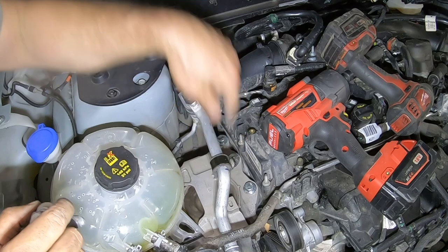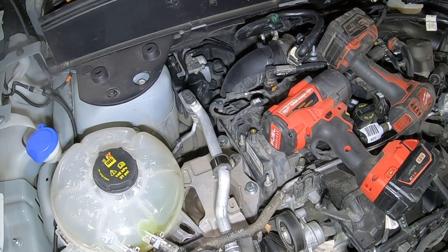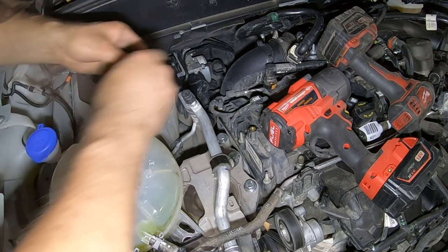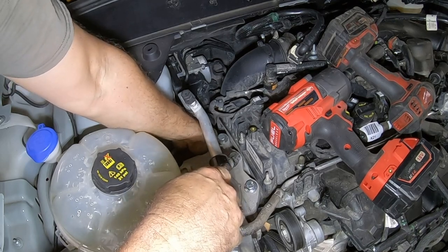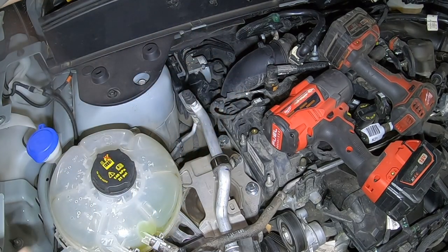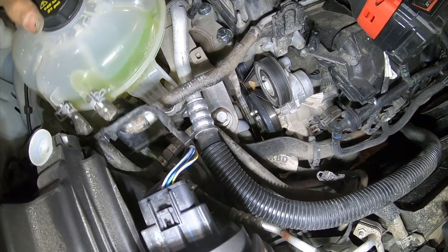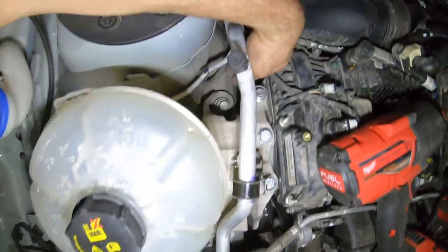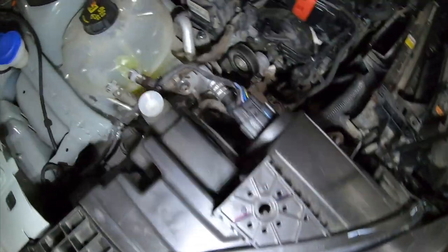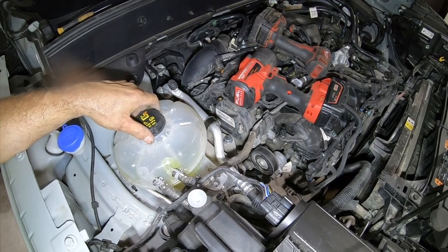As you can see, we're a little off here — the engine has shifted that way a little bit, which I think we can correct with the jack. Just going to pull a little bit back towards me. Did you hear that drop right in? That's the sound of a plan coming together. Once you take things apart — this bolt, this bolt, these two here, and then these three — you can get this whole thing off, put all the spacers in, and put it back together. Let's double check everything, put the engine cover back on, and then move on to the rest of the car.